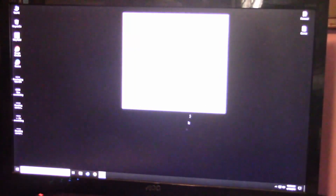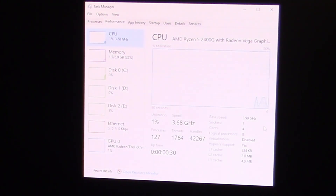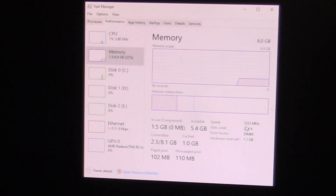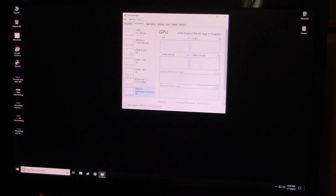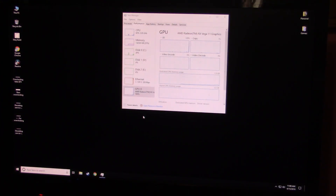It's loaded so it must be stable. Let's look in Task Manager at the performance - it's reading 3.99 on the CPU cores. The memory looks like it is overclocking to 3333 megahertz. The Radeon Graphics isn't showing the clock speed here, so let's go into MSI Afterburner and see what it's showing - see if it's showing over 1550 or not.